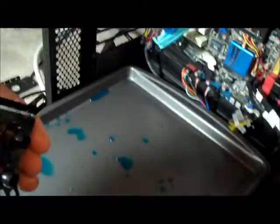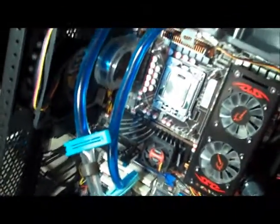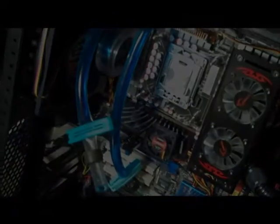Wow, I'm quite surprised. That actually worked. I moved the clips down to reduce the amount of fluid loss, but it's preventing any more fluid from traveling down into the lines. And my drain pan worked perfectly. So alright, next step, I'm going to go ahead and install the graphics card, add one new length of hose, finish up the loop and put it back together.